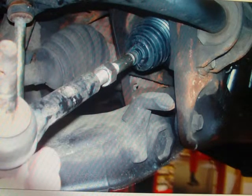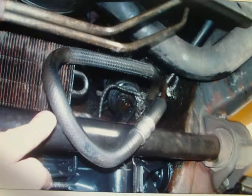You'll put this nut on your new tie rod as well. So do both sides like that. The other side was 23 turns, so don't let that fool you. So this side was 30, the other was 23, and that's where the wheel alignment was. We took it to a shop just to have it checked to confirm that the alignment is okay.